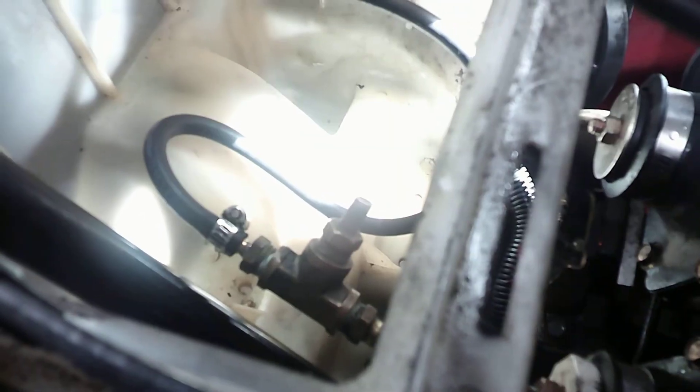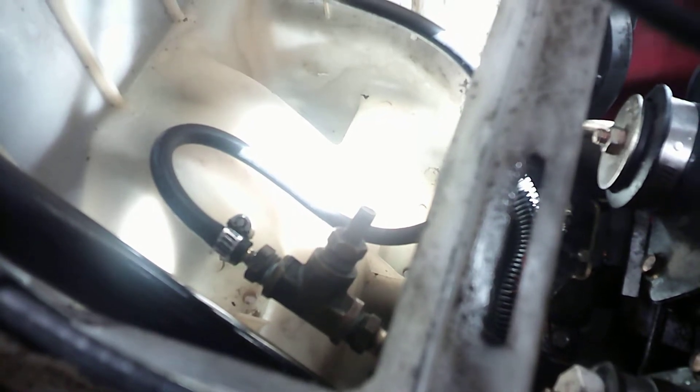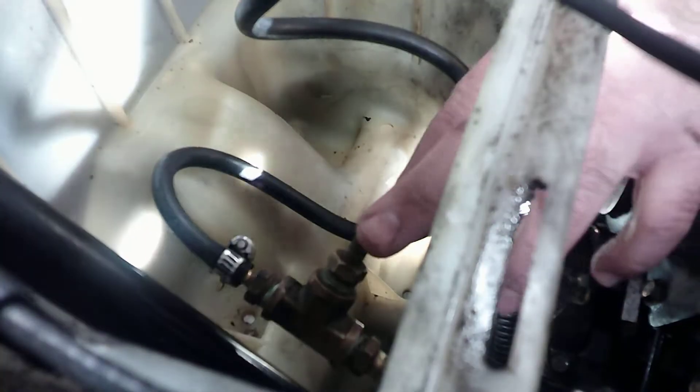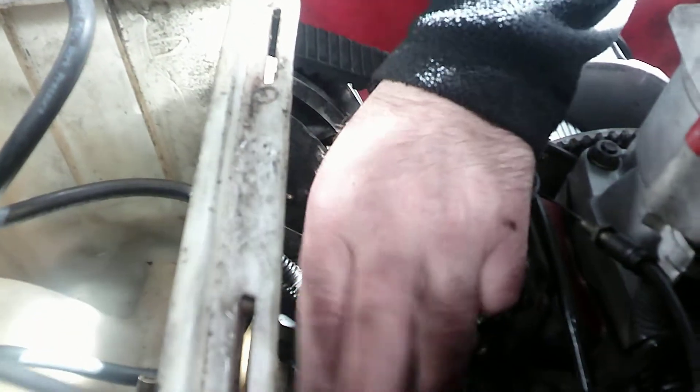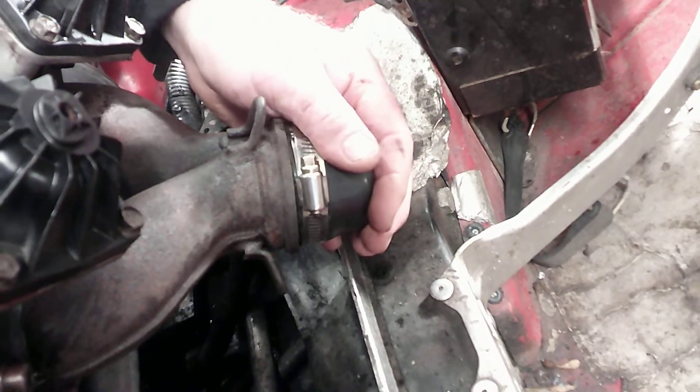Power sports — we're going to do a leak down test today. We just rebuilt this engine top end. This is how you do a leak down test: there's a gauge and you have a T, and then you put a connector. I like these exhaust connectors, they seem to work well. I just kind of made that myself, and over here I found a piece of rubber that fit the exhaust manifold.